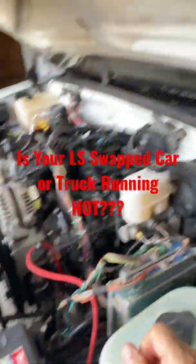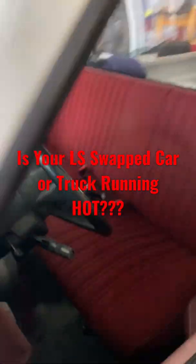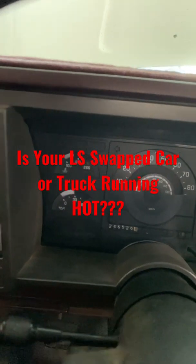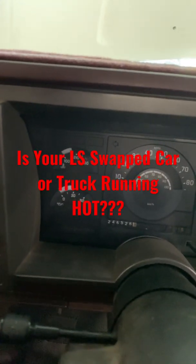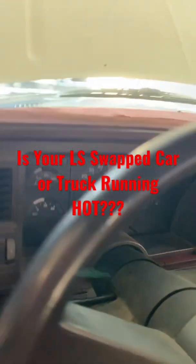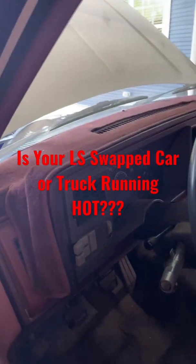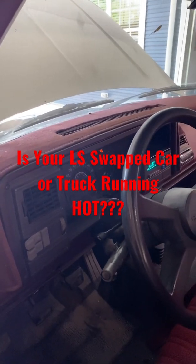I was able to disconnect it from the radiator and add a gallon and a half of antifreeze and distilled water solution, and now it works great. It's been running about 15 to 20 minutes with the air conditioning on in the garage and it does not overheat. So if you've rebuilt the top end of your motor and had it all apart, be sure to fill the radiator with fluid, but also start from the upper hose.